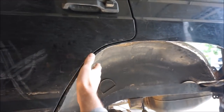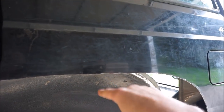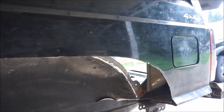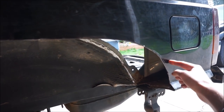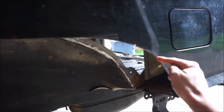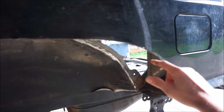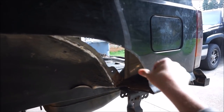So I just used my angle grinders, you guys saw, to cut this. I tended to favor the inside of the line, like the bottom part of my drawing, especially with using the cutoff wheel. The theory behind that is that if you cut too high, on the top side of the line, you're kind of screwed and it messes up your whole cut. But if I cut towards the bottom side, even if it's not perfect, I can always take a grinder back and fix it.